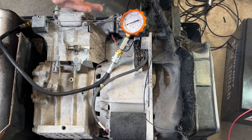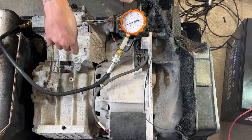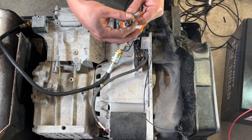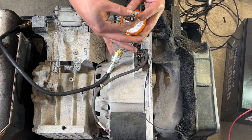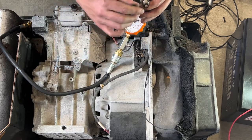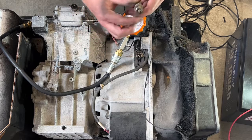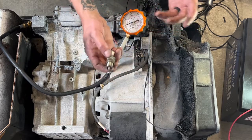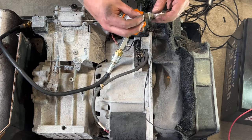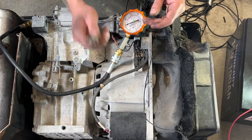I haven't done the compression test yet, so you'll see the results with me. One note: when I pulled this spark plug out, it was loose — the last guy that touched this put it in way too loose. You want them super tight. What happens if you put them in too loose? This thing vibrates like crazy, the spark plug works its way out, you end up with combustion with just a few threads left, and it's going to pop that out — trashing the threads. Now you're in a real pickle having to pull the whole thing out to fix those threads. So make sure you torque your spark plugs. I've learned that the hard way; I've had customers come back with loose plugs. Whenever you're doing spark plugs and you can get a torque spec, torque them.